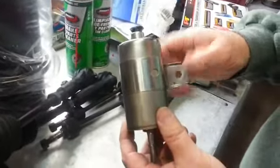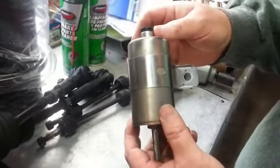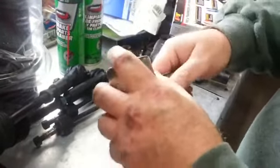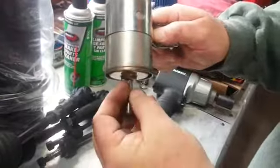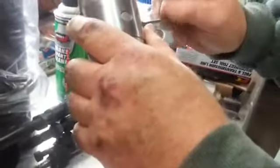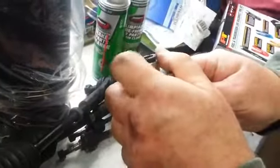I'm not going to say it's super easy, but it's also not super hard if you're even a little mechanically inclined to tackle something like this. So again, while it's bolted to the frame of the car, take this connection off, unbolt it, pull it down a little bit to where you can get your hand on the filter with your fingers.